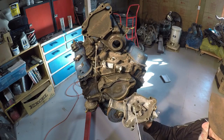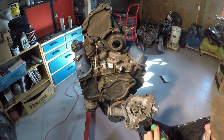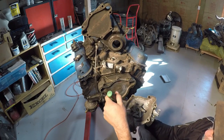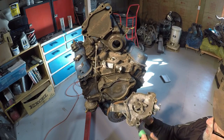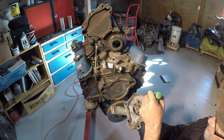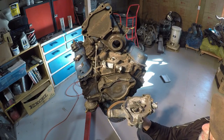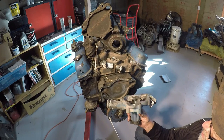So when the thermostat's closed, this thing can zing as fast as it wants, the water can escape here and go back down into here, as well as going through this hole and coming back up through the bottom and back up. So the water is just circulating around. It can sneak past when it's blown around here. A little hole it wants to go through, then big holes much easier, and causes the whole circulation to happen.